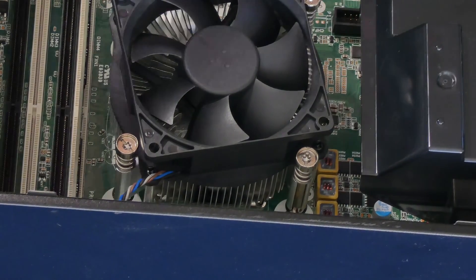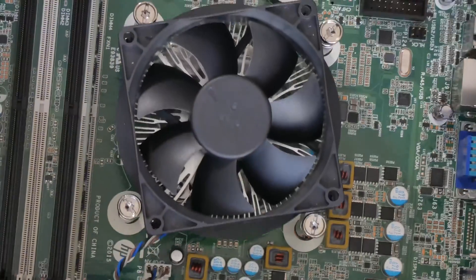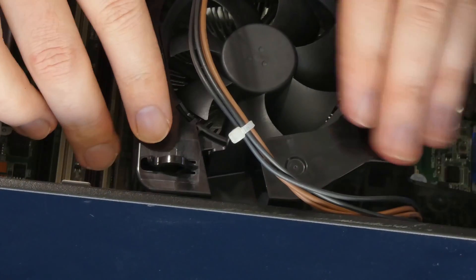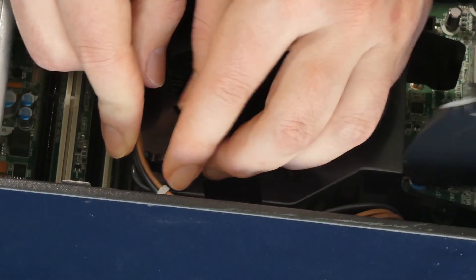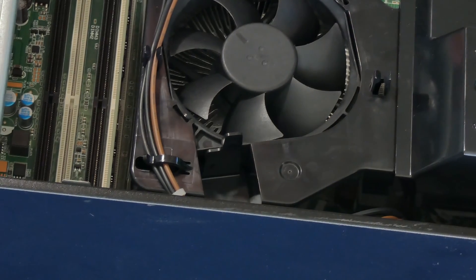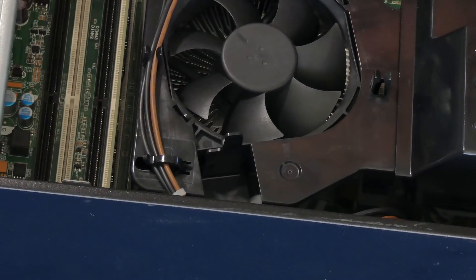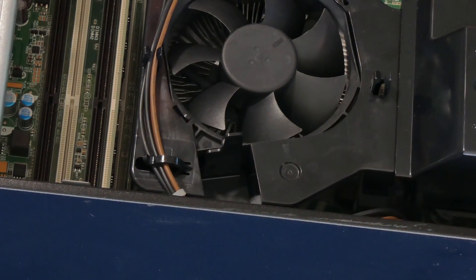Last thing left to do is put the cover back on, but first let's reconnect the P3 power cable — just push it in and clip it. Then route the cable back underneath, put the cover back on, and gently push it down until it's clipped in. There you have it, guys! If you have any questions I'm here for you. I have full videos on upgrading a video card, adding more RAM, and other upgrades — there will be links within this video. For the proper compatible CPU, there will also be links in the description box. Thank you so much, have a good one, bye bye!